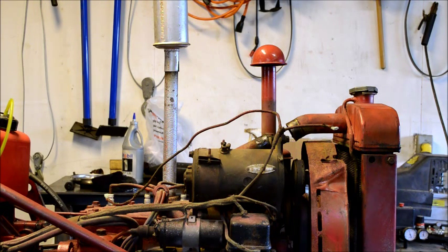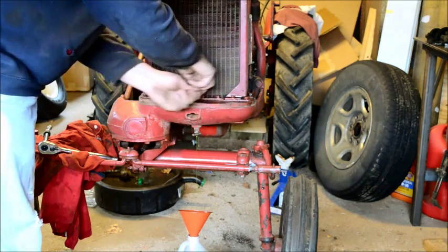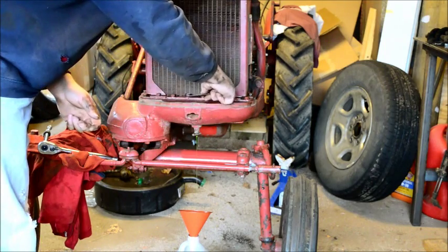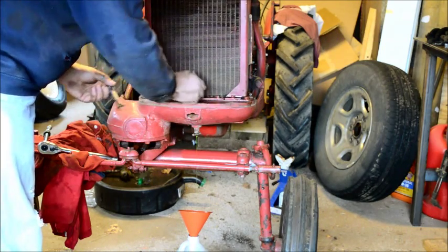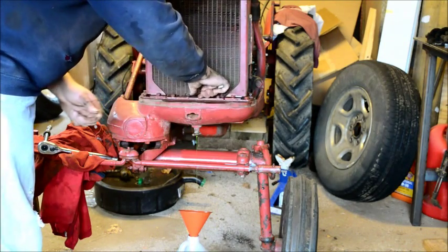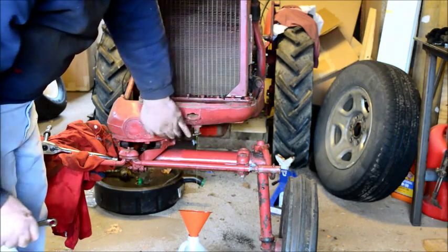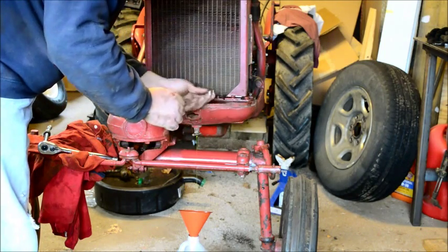Now, the second million-dollar question, I should say the $2 million question, is the coolant level low enough that I can get the radiator off now, that I can start pulling bolts? All right. Who's got their money on a geyser? I gotta imagine this thing can't hold more than a couple gallons up here in the top of it. Gotta imagine this bolster's got most of it. Because the lower radiator tank on a Farmall Cub, for those of you who don't know, is this casting right here. Well, there's no geysers yet. We can start taking bolts out. This will be good.